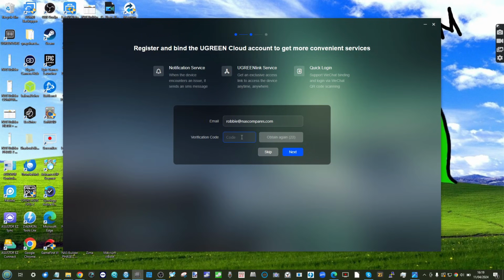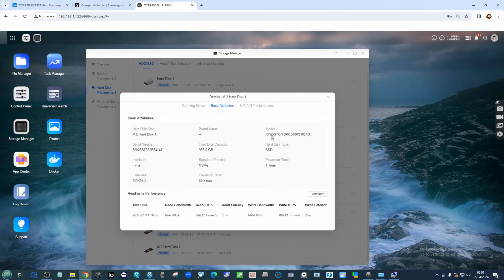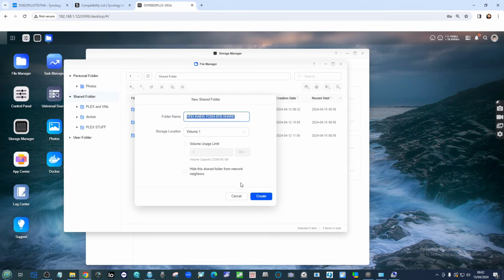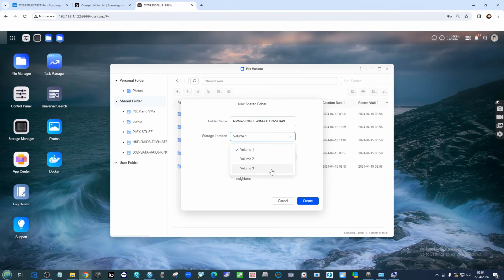But nonetheless, when we dipped into the operating system UGOS and looked at the performance numbers of using the self-testing, we could see that that first drive was still able to hit 5 to 5.5 gigabytes per second in the operating system there. Nonetheless, I'm sure if I played around with the blocks, go down to 128K or something, I could probably eke some higher numbers out of this. But the real takeaway here was that downgrading of that second slot. Now, I don't believe that's being caused by my use of that Kingston SSD, because I'm using the same SSD in both of those slots. But nonetheless, it was food for thought.